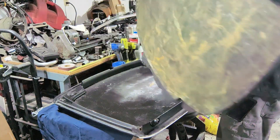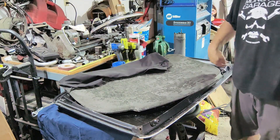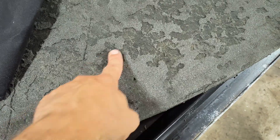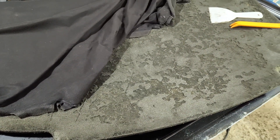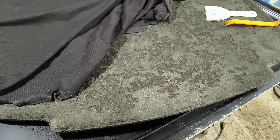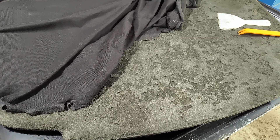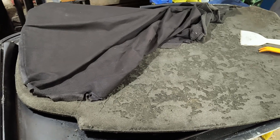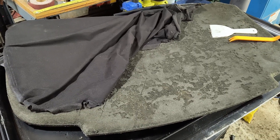The fabric is coming off. What we're going to have to do is remove this fabric — we're going to have to take a wire brush and get all this crumbling mess off. See, it's crumbling. When I first did the headliner in Old Blue, which was, oh my goodness, the late 90s, my buddy taught me to take a wire brush, get all this off, use the 3M Super 77 glue, and you don't have any issues. Old Blue's headliner is still intact — late 90s, it's now 2023, so we're going on 25 years and it hasn't come down yet. I think that's the way to go.